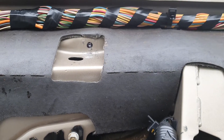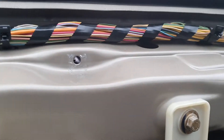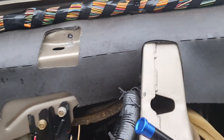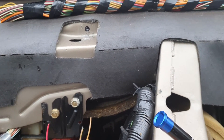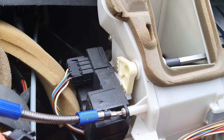You can see these holes here — that's the top part of the dash, and these are actually bolts that come through from the firewall side. So you need to remove the cowling on top and the wiper system to get to some of these bolts.